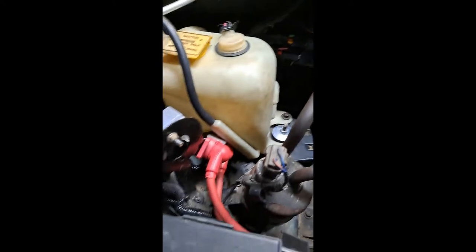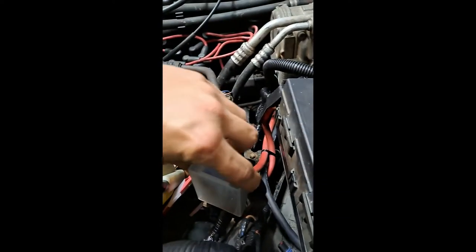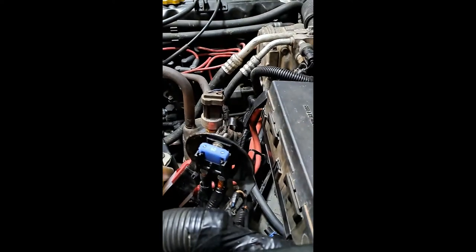But anyway, so the electric fan is in, if you can see that at all. And I might upgrade to a better fan and shroud eventually. And then the 136 amp alternator, I did get that in down there from a Hemi. And see, here's all the cables. I tried to make the routing semi-clean, and bear with me, it's kind of hard to see all this, but I have the 60 maxi fuse right there.